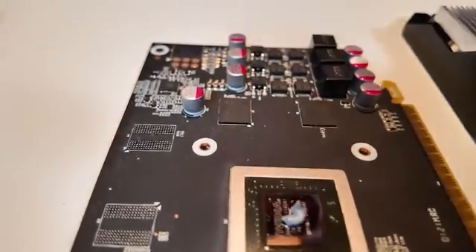With new paste applied we are ready to screw this back on carefully — make sure it all lines up. Once you get all four screws on you should be good to go. You should be noticing a little bit of a difference, especially if it was an older card — you should be noticing those cooler temperatures. This is a 1060, very common, and this one has that back plate on it too.